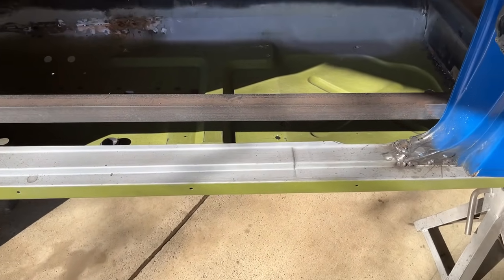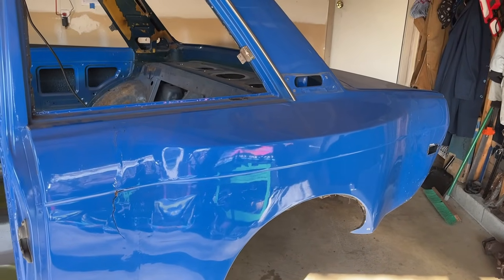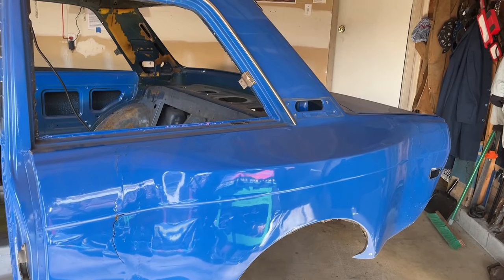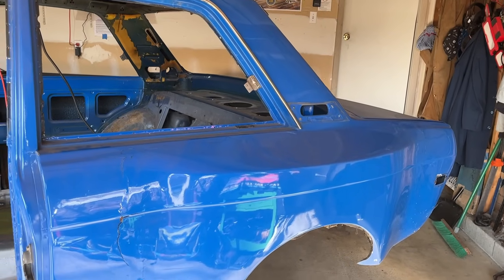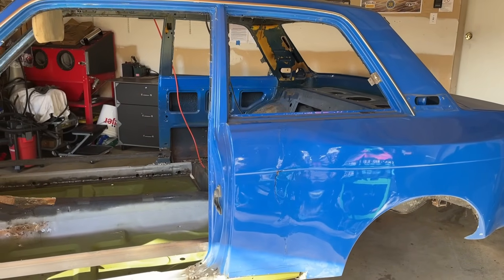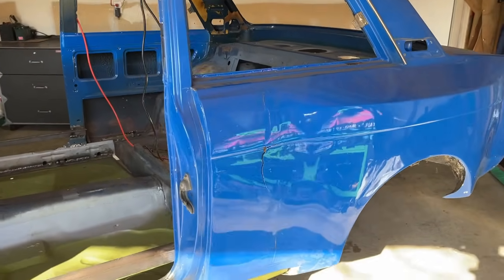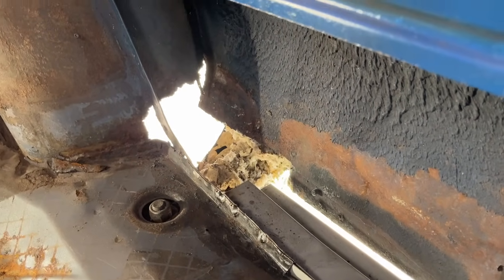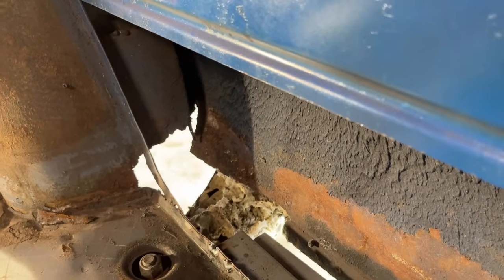I made the rockers. We had to cut out the box flares on this car, which doesn't meet the specifications for the class - they'll probably put it in a different group, but it's just a cool look for a 510. Most of them just have the flat. It was a B-Sedan, and when they upgraded it back in the 70s you could do that. This was a street car - it had twin turbos on it. They did fiberglass work and just kind of cut and chopped different things. We got a lot of work to do back in these corners. They just put foam in and their cuts weren't clean. You can see the cuts in the metal back here, and there's a good amount of rust.